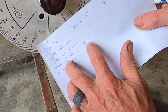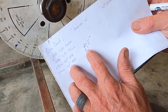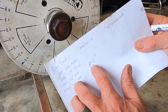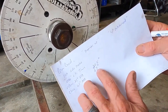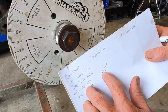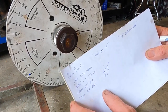Now we're going to compare that to what it's supposed to be. We are two and a half degrees late on the opening and our closing is actually five degrees late. We're not really sure why that is - we've checked this about a dozen times. Either way we're at least two and a half degrees retarded. Once this timing chain loosens up that's going to grow to about four degrees. If we could get four degrees advanced from here, which would be two degrees advanced overall when the chain loosens up, we'll be really close to where we need to be. So we're going to switch to the four-degree advance.